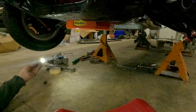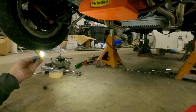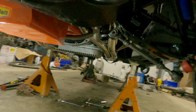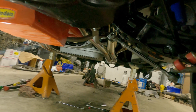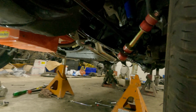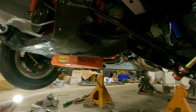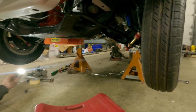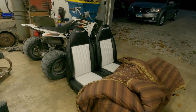There's a dust shield. I had to start putting that together. Then I had to get the special bolts for the torque converter, because they're bigger. They're 7/16 bolts instead of the 3/8 like normal ones. This one's got a 3500 stall. And it's got the deep pan, the aluminum pan with the fins. Cool.